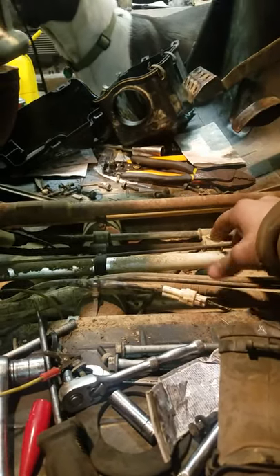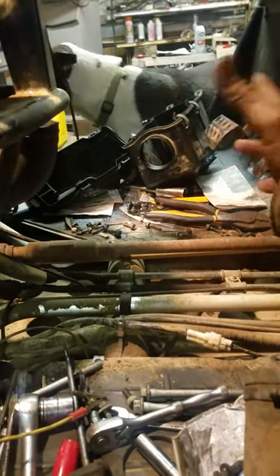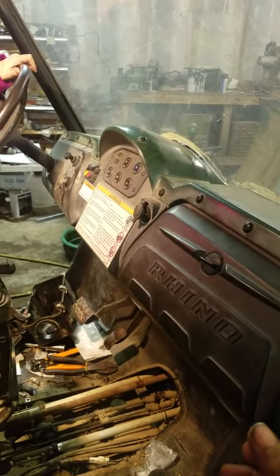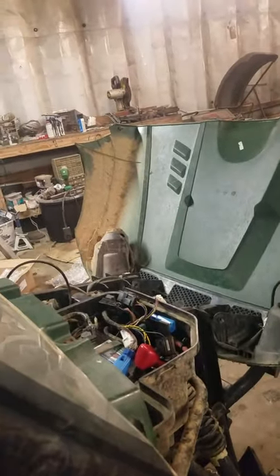I'll demonstrate it now. I've got this plugged in and I'll start the unit — you can hear it missing horribly — and then I'll just unplug it and the problem instantly goes away. The problem is either the speed sensor itself or it could be in the wiring, but we're going with the speed sensor for now. In the diagnostic process I also borrowed a CDI from a friend and tried it — still did the same thing, so I ruled that out. I've got a neutral light — I'm going to let my daughter hold the camera.